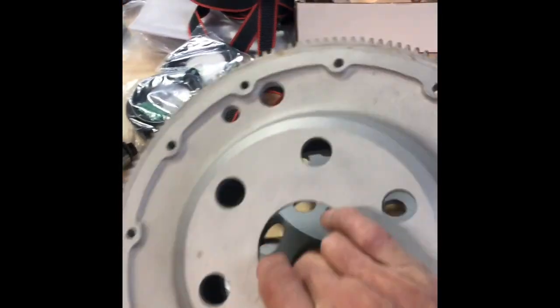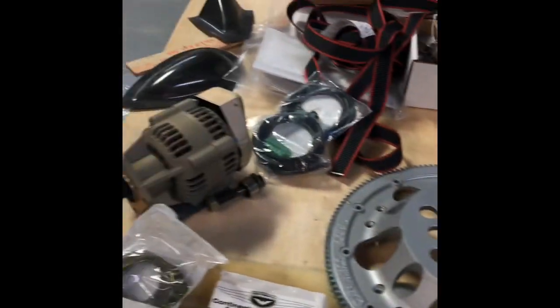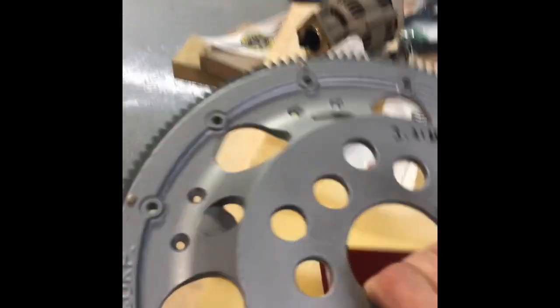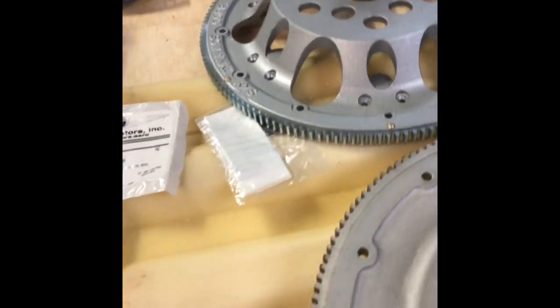The engine came out weighed just like it is with these magnesium parts — I weighed it with the leads included. The standard flywheel came in at 6.07 pounds. I'm running the SkyDynamics magnesium flywheel, which already has lightening holes formed in it and no pulley for the alternator, and it weighs 3.21 pounds — almost half the weight.